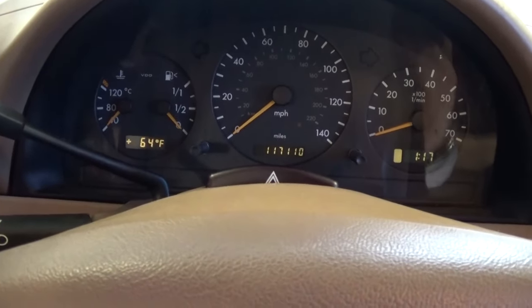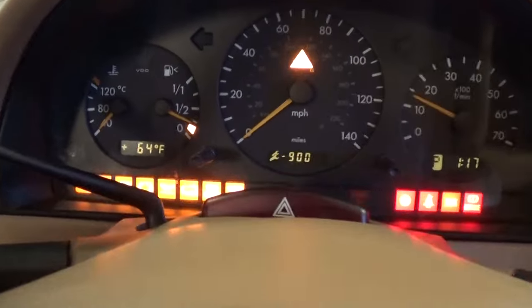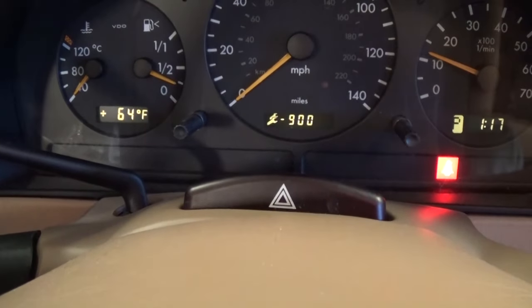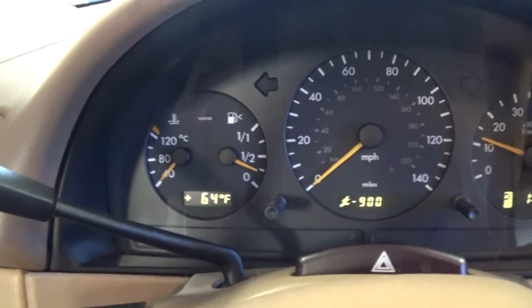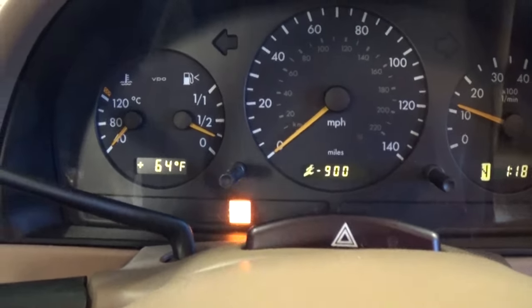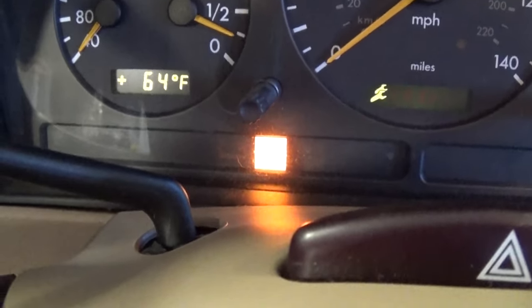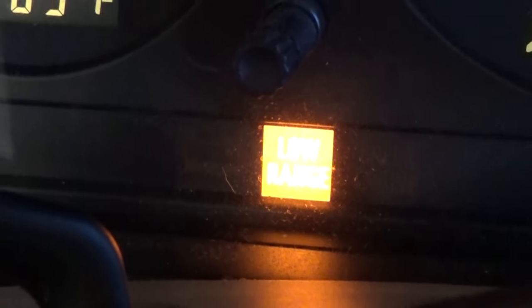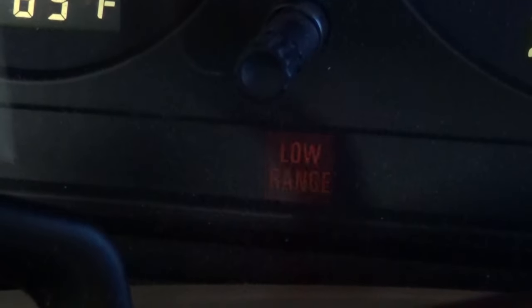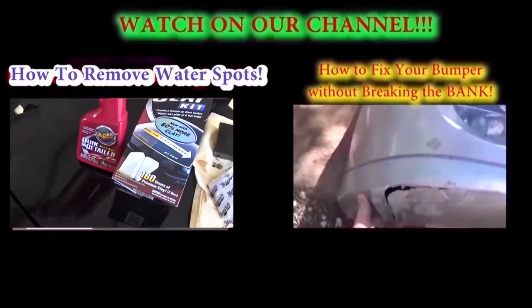We replaced it. Now we're going to go ahead and start it. As you can see the light is not blinking at all. If we put it in neutral, everything should be good. It's blinking three times and then it stays on, which means we're in low range right now. Now you just turn it off and it should go off — and you can even hear it changing gears.